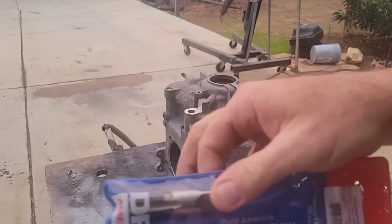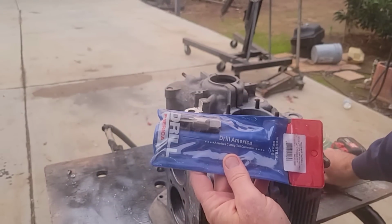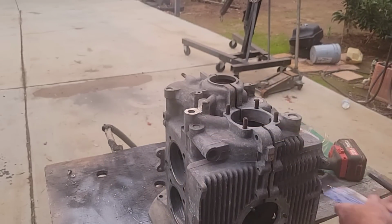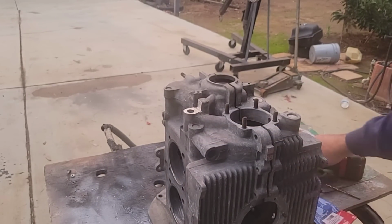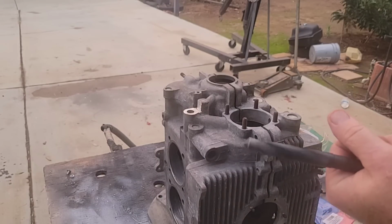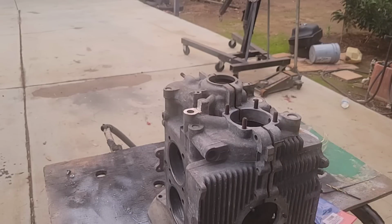Okay, drill and tap set. I think I'll put this in the description for you guys. Pretty cheap on Amazon. It's got to be the proper size drill. If you use the wrong one, you can cause a lot more problems. Especially when you got a magnesium case, it's not easy to tap, so you got to make sure you have the right one.